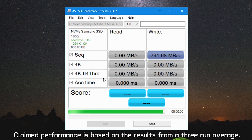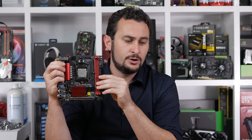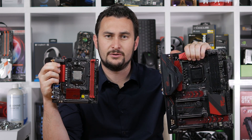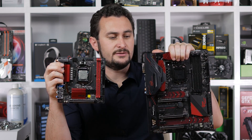I installed the Samsung 960 Pro 1TB SSD in the M.2 port on the underside of the motherboard and ran the AS SSD benchmark. The SSD performed as expected, providing a read throughput of 2.8GB/s with a write throughput of 2.1GB/s. As for gaming performance, this mini-ITX motherboard will perform like any other Z270 or Z170 motherboard — and that's really true for any 100-series or 200-series motherboard.